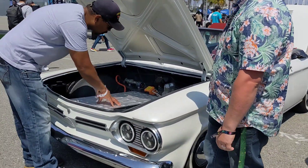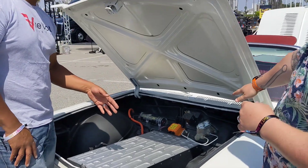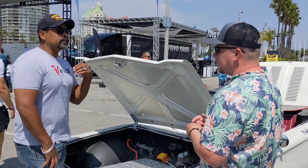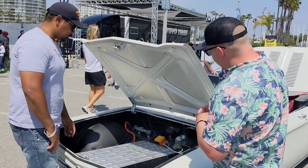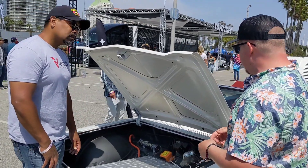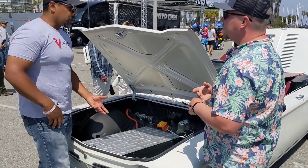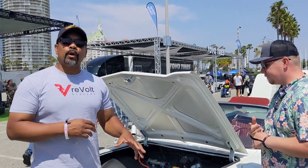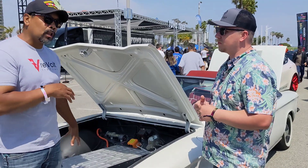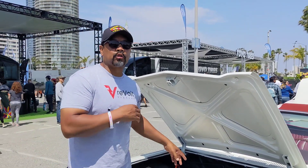I noticed you've got a couple other things up here. I don't see any electronics under here — are we using manual brakes? I do have manual brakes, but I have a pressure transducer on the other side of that line, so this has full regenerative braking. And what's the big orange plug? It's called an MSD, or manual service disconnect — probably one of the more expensive parts in line with the electrical. It makes it so that anybody working on this car can pull the latch off that plug and disable the entire high voltage system. Anything over 48 volts is considered high voltage and you can get a serious jolt, so these safety features are huge.